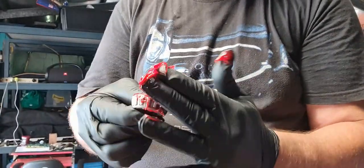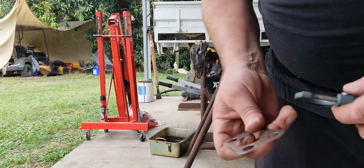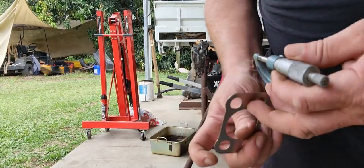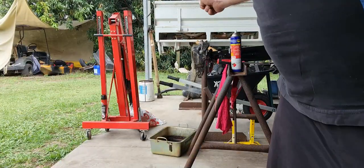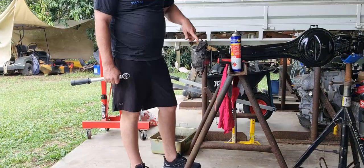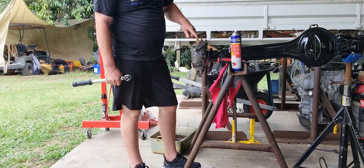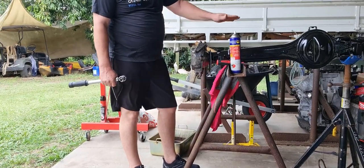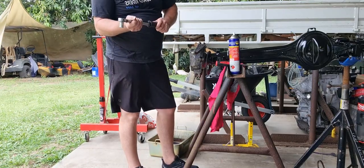The hubs are on. I'm just going to measure these shims up with Mickey's micrometers — four of the 0.5s right there. I've got 0.5mm shims in there, two of them, one top and one bottom. I put the hard washers in first, not the cones, because if I do have to pull this apart again those cones get jammed in there. You'd be flogging stuff that we've already cleaned up. I find this the easiest way.